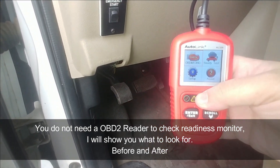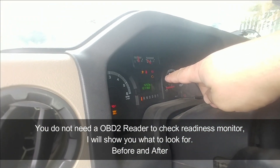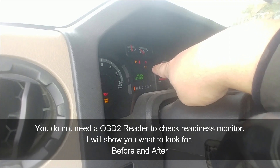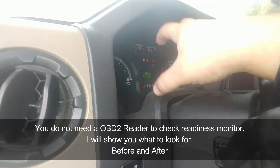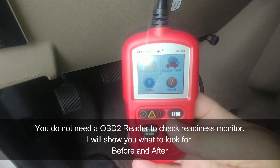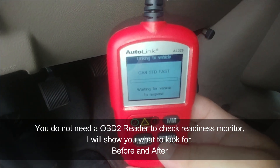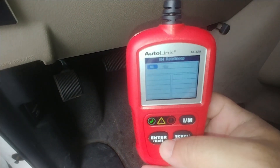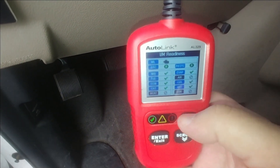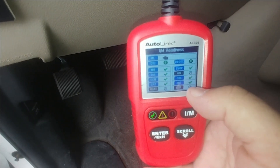You're going to notice that you have power there, but you want to go ahead and turn the ignition on so the check engine light is on, and the car's engine itself should be off. On my scan tool right here I'm going to hit IM — this stands for inspection monitors. These run under 30-40 bucks, and you can see all my monitors here are ready. Basically I have everything green.